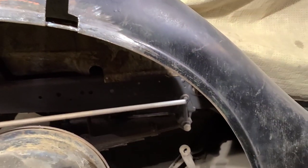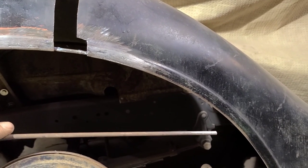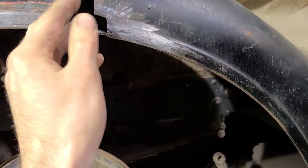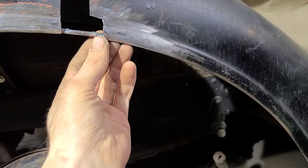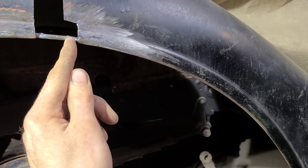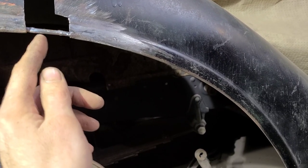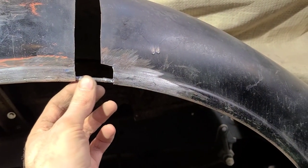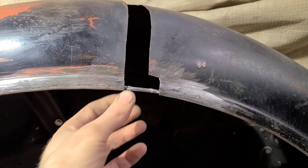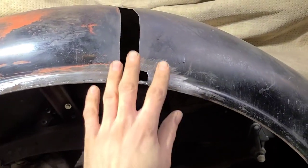I found a piece of rod that was the same thickness as the rod inside here - this came out of a 1935 Maple Leaf hood hinge, which just happens to be the same. I offset the welding section of rod from where I'm going to be welding in the outer sheet metal piece. The rod is welded here and here, and our other seam will be offset from that so we get a good solid weld into the rod. It just helps to make the repair a little bit better. Next step, I'm going to get this section put in, then stand back and look at the profile again.